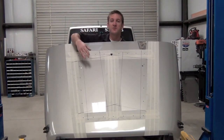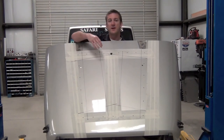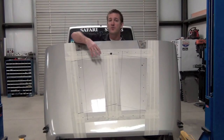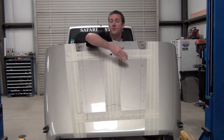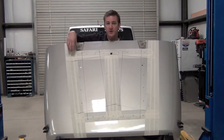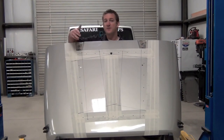We've measured off, plotted our holes and cutting lines. There are a few different cuts you can choose based on the airflow and structural integrity you want to keep with your hood. You can do minimal cutting, which keeps all the structural integrity but gives you very minimal airflow — pretty much just for looks. You can do a moderate cut, which still maintains structural integrity and gives you some decent airflow. What we're doing is making the full cuts along the lines of the louver panel for maximum airflow off the engine. We've also measured our corners to make sure both sides are an equal distance from the hood corner and that the cut lines are straight. Then we'll make our cuts, even out the lines, toss a little paint on it, and be ready to put the louver on and start securing it down.